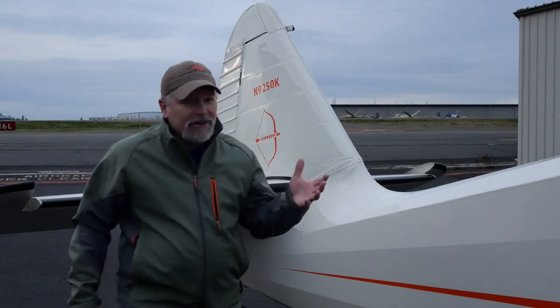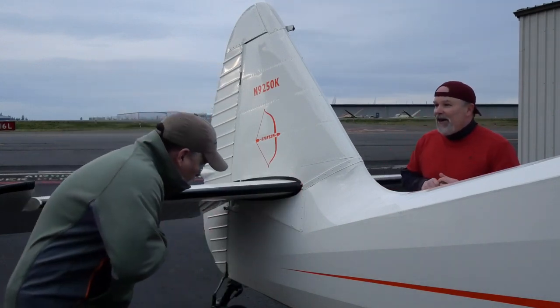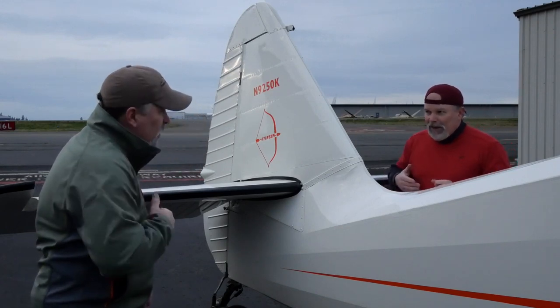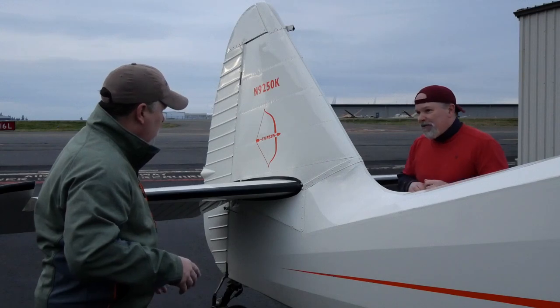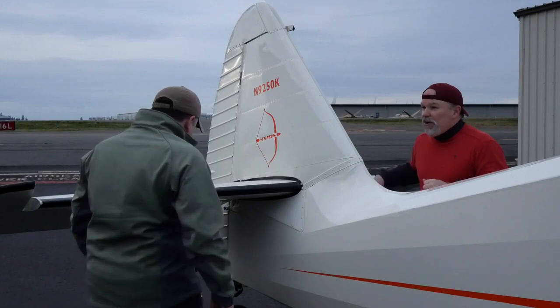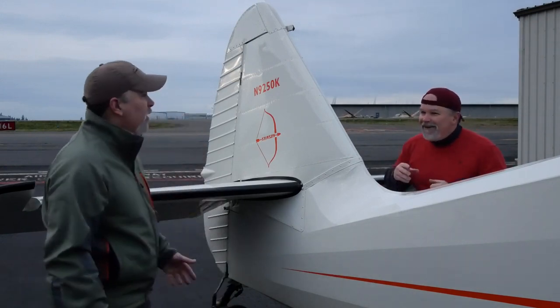Welcome to another video. We're going to take a look at my Stinson. I just want to let you know I did some work on the tailwheel. After that landing at Apex and the shimmy, I just wanted to make sure everything was okay. Everything's good. I had to loosen up the chains a little bit, so you might feel some differences there.